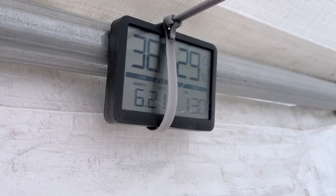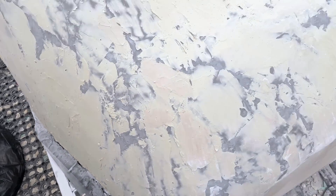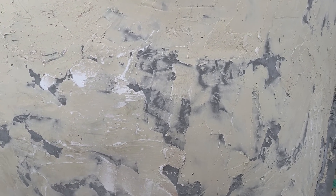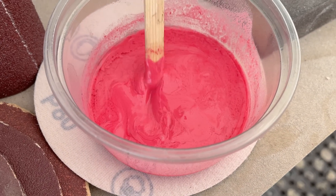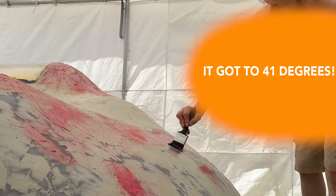The next day, and it's quite warm in here. We've had a slight problem in that some sections of the filler haven't fully hardened — only in some small areas. I thought I'd been really careful mixing the hardener and catalyst, but apparently not. I've never had that problem with filler before. So I'm just going to use a paintbrush and paint catalyst all over the areas I don't think have cured well, and we'll see if that works. If it doesn't, I'm going to have to chip off some areas and refill, and I really don't need that because I want to finish today.